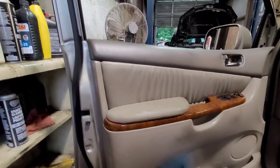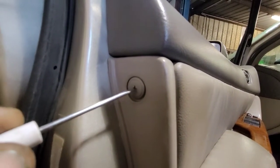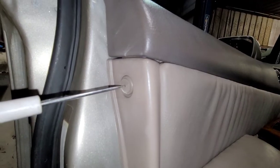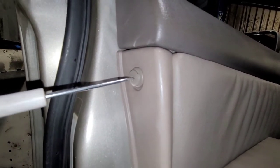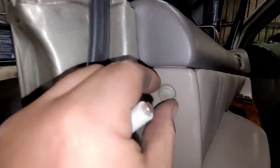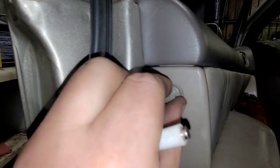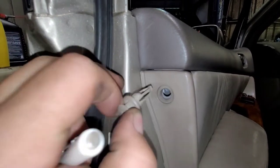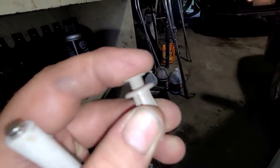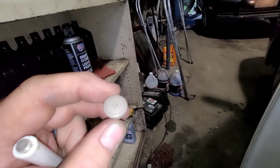I just noticed it's got a push pin - these are plastic and you could use a Phillips screwdriver or a little pocket screwdriver. But you've got to be gentle with it, because all it is is a plastic anchor. You want to be gentle, because if you're pushing in on it, you'll just push the center piece back in and you'll never get the anchor out. It's just like a wall anchor at home when you're hanging up a picture - it's just plastic. If you put pressure on it, a lot of times it just collapses on itself, so you want to do it nice and easy, nice and gentle.